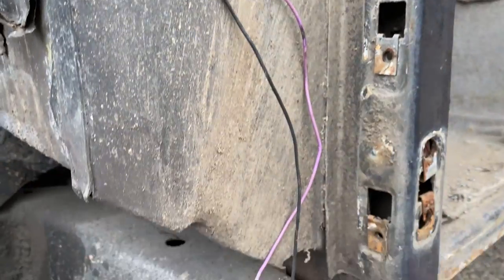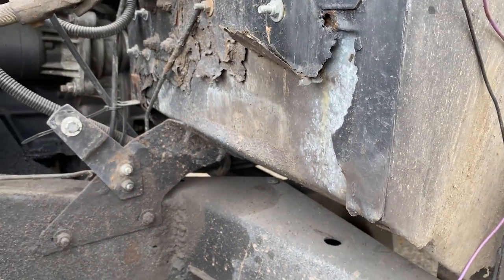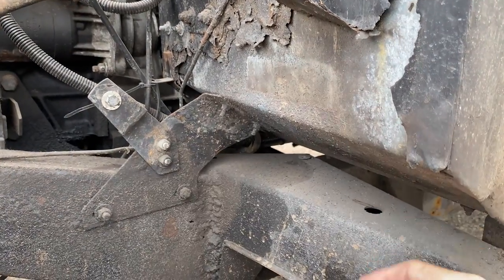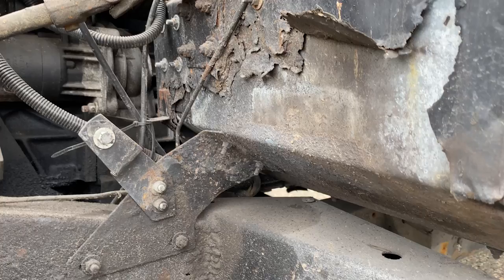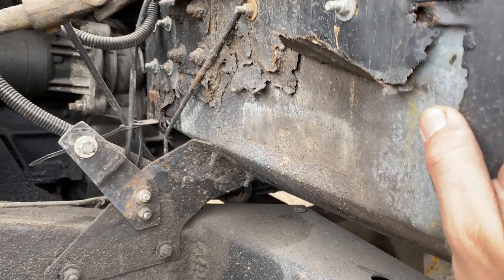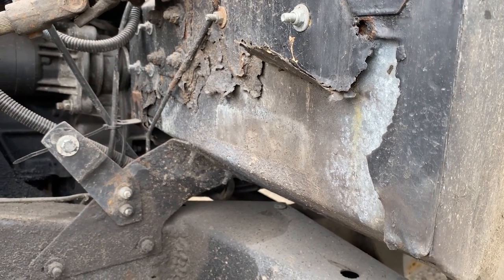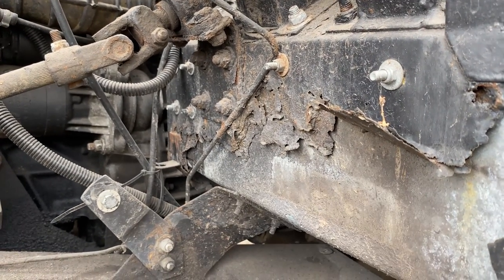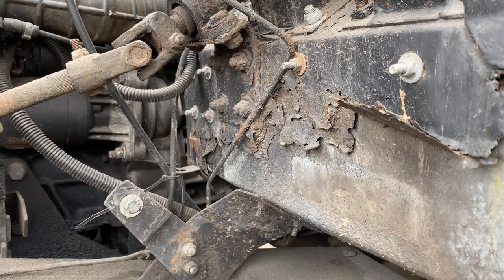Come on down this pillar. And the exterior looks good, but this bulkhead has been poorly patched. Looks like they just bolted in a piece of aluminum there. On the inside, it's fine. And if this was just a farm truck that you're running around kind of carrying stuff, it's going to be totally okay. But for us, we're going to need to replace this with a brand new bulkhead, which gives us time to paint it and kind of get it back to factory fresh.